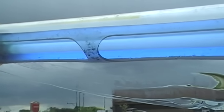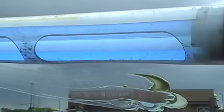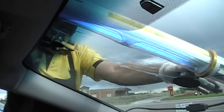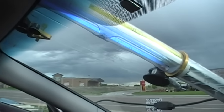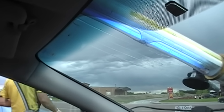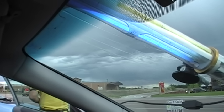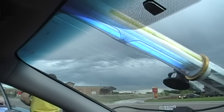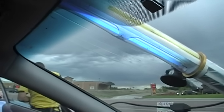With this cure lamp, it won't take very long for this to cure — it's a nice, big, powerful cure lamp. When you're doing these cracks, you don't want to just yank that tool off, because that can disturb the windshield. You actually want to use a screwdriver and put it underneath the suction cup and slowly press against it until it breaks the seal, because if you yank on it, you can disturb the crack and create an air pocket. So you just want to gently remove it.